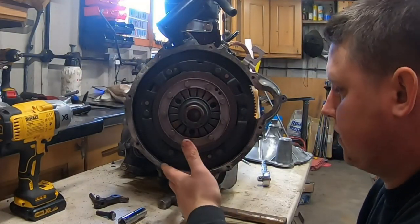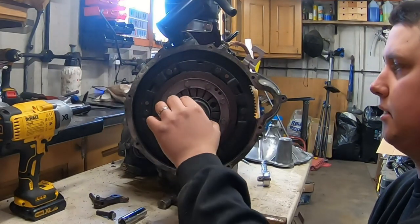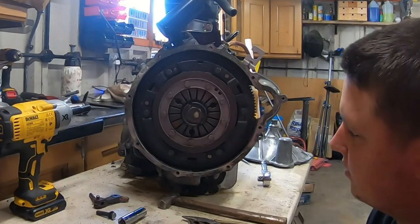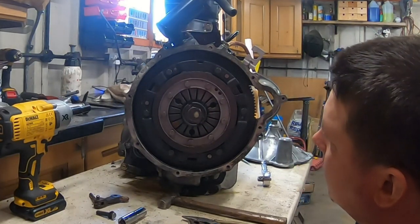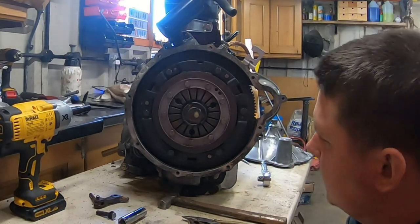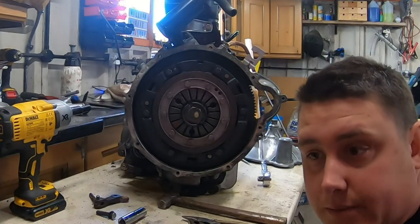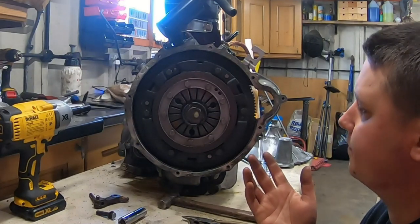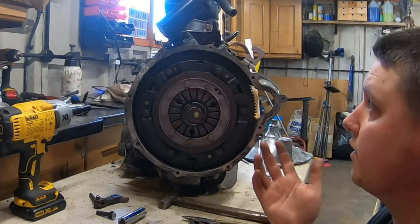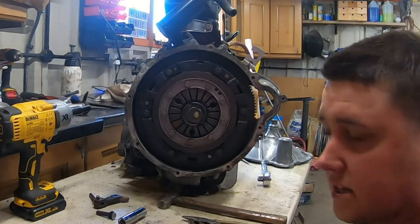Here we have the setup of the Verto clutch — very different to the pre-Verto in that it's all one unit. You've got a cup that forces on the diaphragm; the diaphragm contracts and applies the clutch. It's a nice little setup and I think it's a much better style of clutch personally. Let's get this flywheel bolt out, use my locking tool to lock the flywheel in place, get the flywheel off and see what the damage is. The reason I'm changing this is that the clutch is an unknown quantity, but while the engine's out it's worth replacing bits that are easier to do off the car, and for the price of a clutch kit it's definitely the best way to go.